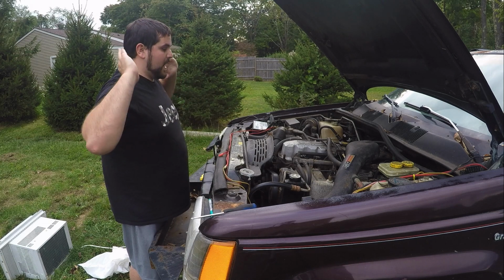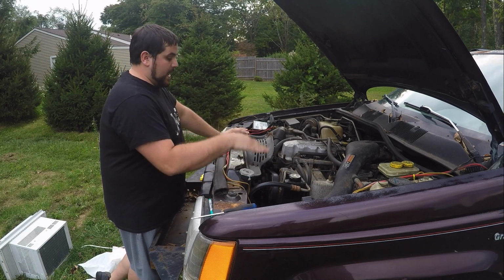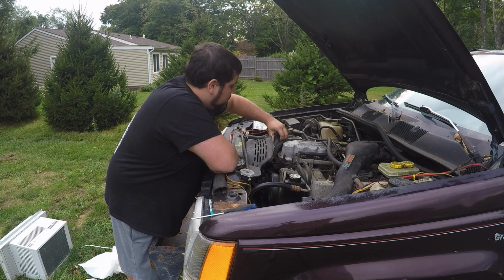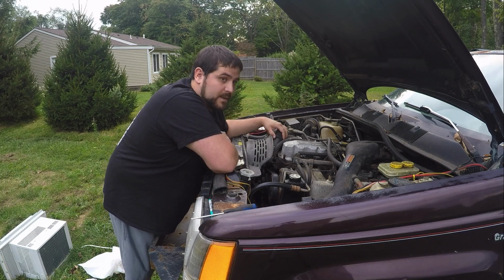But those are my highly recommended coolant upgrades: the tow radiator and the mech fan. If I had to pick two, hands down, those are 100% worth it. They make other ones where you can hog out your thermostat housing. My buddy did that in his, and it cooled too much at that point, to be honest.